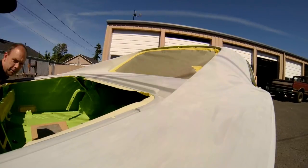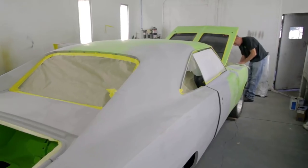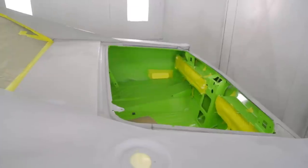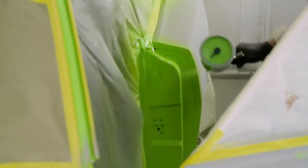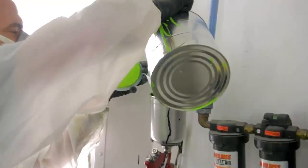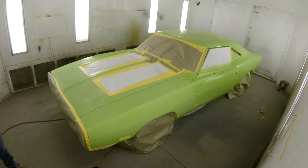If you're going to do a quality job on a restoration or on any car in the way of painting, there are just certain things that have to happen. The most important is that the products you're using are good quality — not substandard products from the local auto parts store. Once the bodywork is done and the filler is on there and the car is massaged out, it gets the primer — two or three coats of high build primer — then it gets block sanded. That takes out imperfections, waves, movements in the body style lines that will show up with paint on them. Then it gets re-primed, then blocked again. Those are all the steps necessary before you apply paint. Once that's ready, you mask the car, mix up your sealer, apply one to two coats of really nice sealer, then you're ready for your base coat, clear coat — walk away. The best feeling a painter ever has is when he slams that door for the last time and knows the rest is up to God.